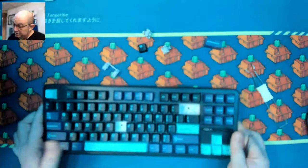The chin of this keyboard sits at 23 millimeters above the typing surface, while the back sits at 32 millimeters, providing for a default typing angle of 6 degrees. Flipping out the first set of feet, you will raise the back up to 35 millimeters, changing your angle of typing to 8 degrees. Raising the final pair of flip out feet will take the back height to 44 millimeters and change the typing angle to 12 degrees. This keyboard MSRPs for $54.99 as a wired single mode version, or $65.99 as a 3-mode version from MechKeys.com.